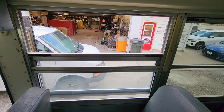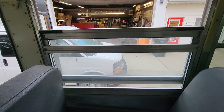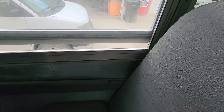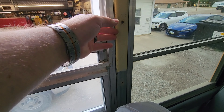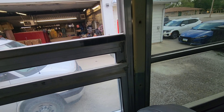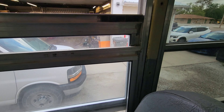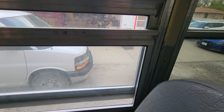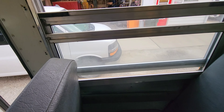Now the window is just kind of hanging there. What you're gonna do is start prying down here. If you have a heat gun, you can heat up this part of the window — it's half-assed glued in there — so heat that up to help release the glue a little bit. I'll start getting this window out and show you. There she is, pulled out a little bit.